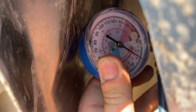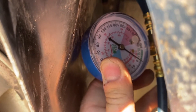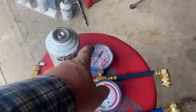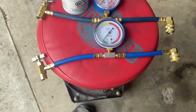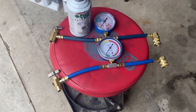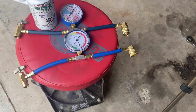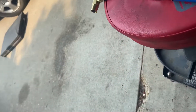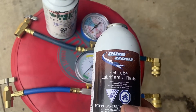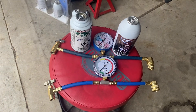Working by myself today, so I'll just show you the gauge when it's done. I ran into some problems with the hose I was using — it wasn't letting any of the refrigerant through, so I ended up going to buy a different hose assembly. I'm hoping that one will work. It seems like when I open the valve, some refrigerant comes out of the end. I've already put a container of this ultra cool oil lube in, and now we're going to try to add the actual refrigerant.